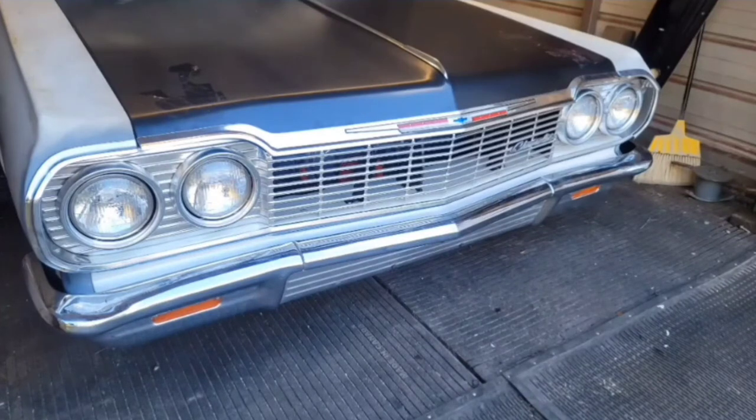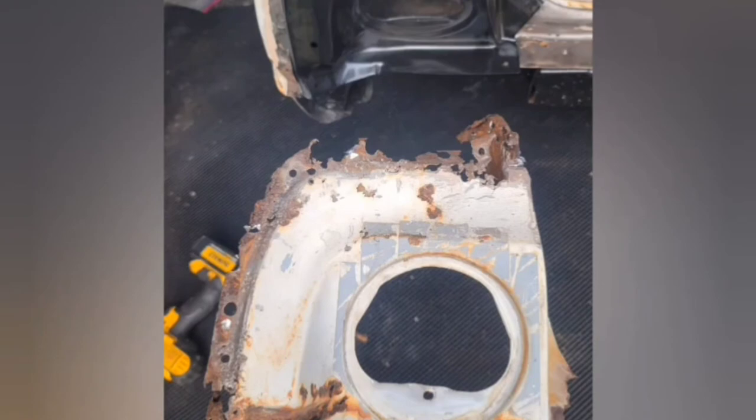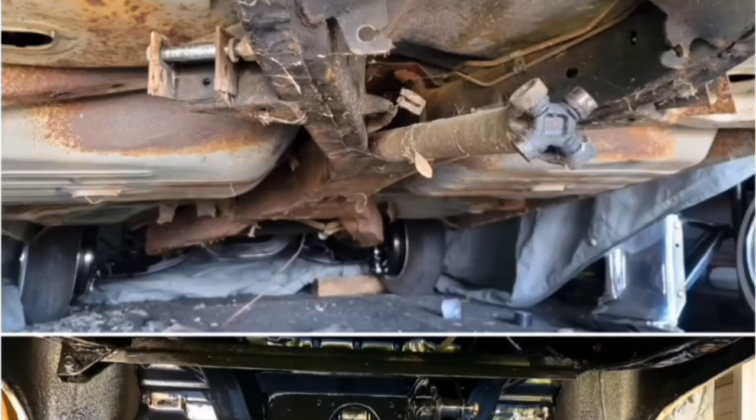You're about to see a picture of it with the whole front cap off. The only bad spot I had was where the taillights are — they were pretty rusted. So I cut them out and I'm replacing them with panels from Classic Industries — they've got pretty good prices and they're quick to deliver. The underside — top of course is before — it was pretty bad. I pressure washed it, used a buffer to knock all the rough rust off, and made sure there were no holes. The floorboards are super sturdy.